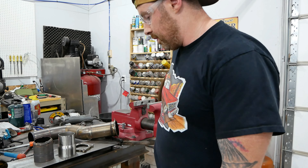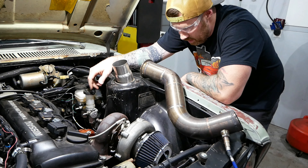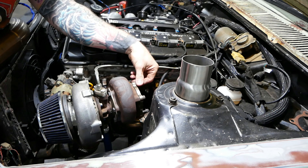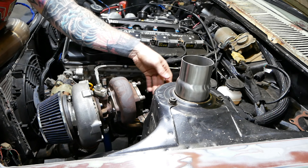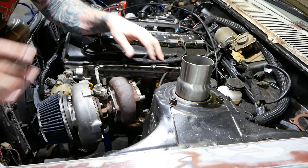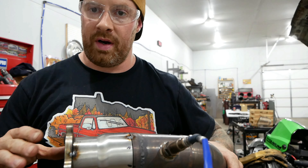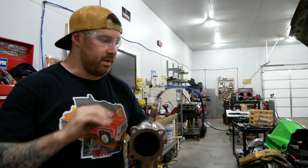We're trying to save for a bigger project coming up in the future, so I'm trying to reuse as much as I possibly can and only buy parts I absolutely need. It's now everybody's favorite time — trying to make your pipe fit somewhere. Right here off the back of the turbo, I have the flange bolted back on loosely just so I can make sure it's centered. That way it should be close to this orientation when I get the whole downpipe welded back on the car. Here is the very quick mock-up of the new downpipe, and we're going to throw this in the car and just see how it fits.